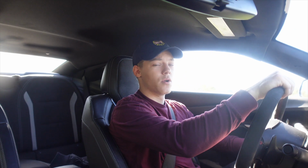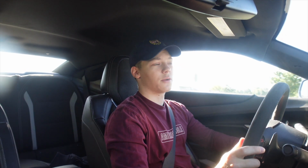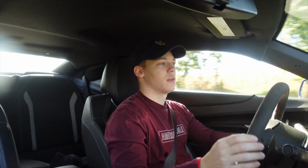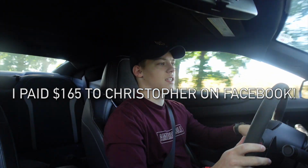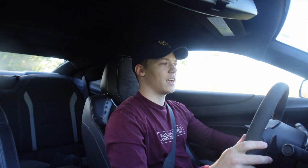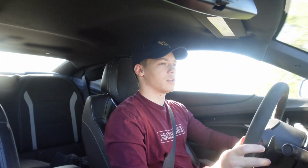So moving on, the next thing would be the LT2 intake that we just installed. I haven't gotten the refresh on the tune because I have to burn off the E85. My tuner recommended that I bring it to him on 93. And since it's getting colder up here in Michigan, we don't really want to run E85 because the winter E85 is crap, and I don't want to gum up the engine or anything like that.